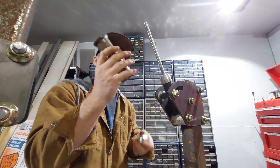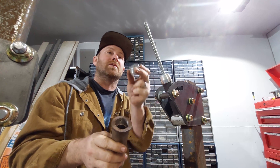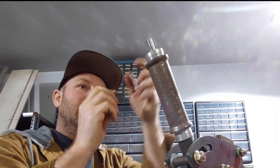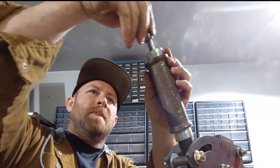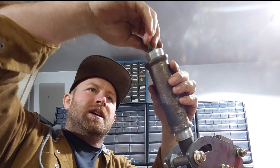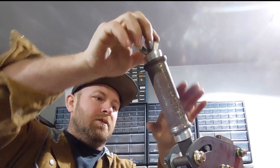This makes it really nice because this is all adjustable — you tighten this, loosen this, you put it wherever you want. And then to center it up, I've made these conical cone washers. Stick that on there, and when you tighten it up, these little cones cinch it down and make it perfectly straight along with the lining.